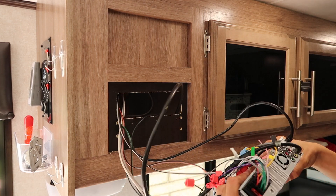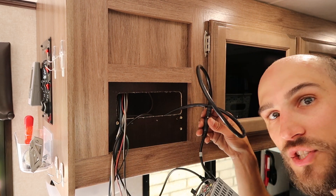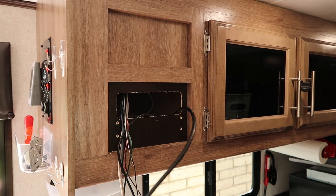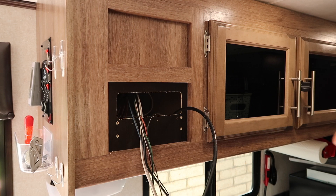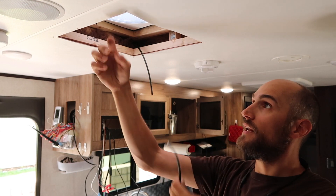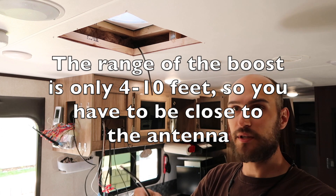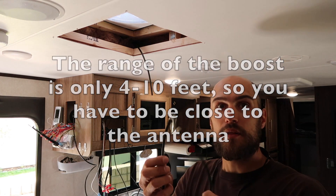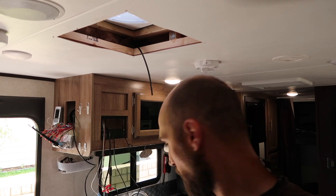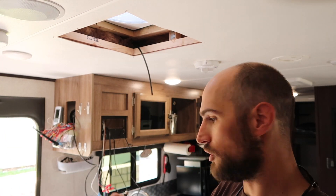This is basically just like a car stereo — it's got its plug and antenna. This one also runs to our TV so you can watch DVDs and get sound from the TV into the speakers. There's definitely 12-volt back here since all this stuff runs off 12 volts, so I'll find a good spot to connect the wires. For the internal antenna wire, I'm going to run it from the fan area and maybe double-stick tape or velcro it to the ceiling. There are two different ends on this cable — a male and a female — and the male end goes into the antenna, so I need to make sure I run the female end back to the receiver.